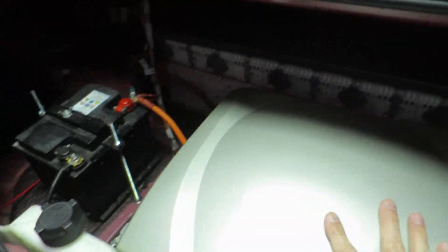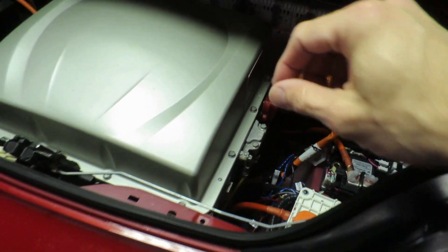By deduction I figured it was overheating. The power distribution module here, which does the charging, actually has exhaust and input for water cooling. When it's in the Nissan Leaf it's all one stack, so the cooling cools the motor, the inverter and the charger all in one system. But I've separated them — the inverter and motor up front and the charger at the back — so I needed to make a cooling system, which I've done. It's a little bit over-engineered to be honest, but I thought I'd just share it.